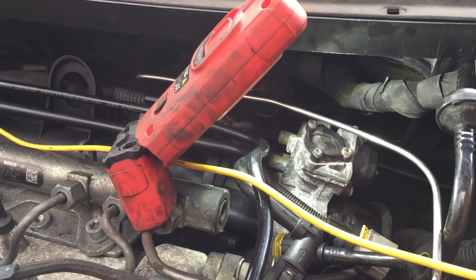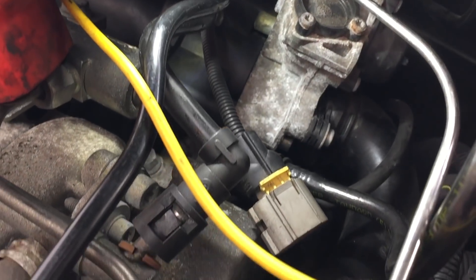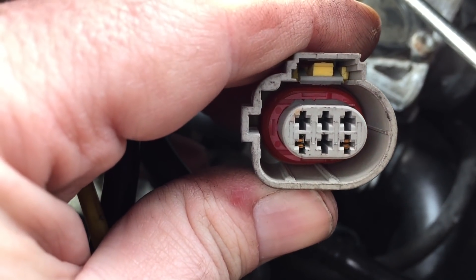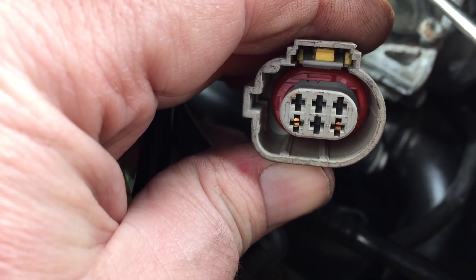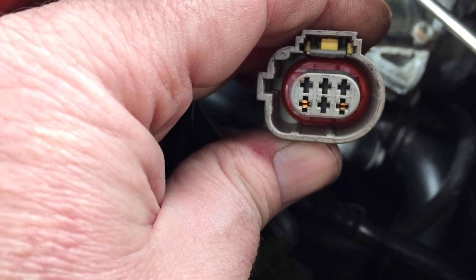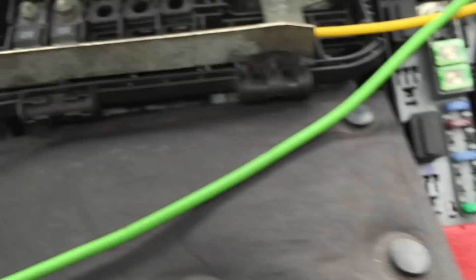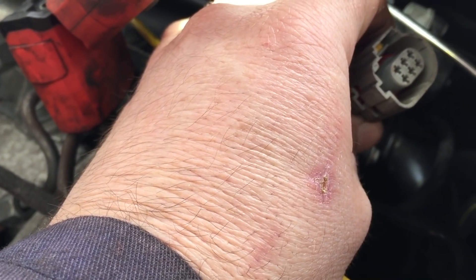Here's another thing - I thought I'd check out the EGR valve. It resides down the back there. I've got the six-pin connector plug but there's actually only two pins of that populated. This EGR has no position feedback to the ECU, so it'll just be 12 volts and a pulse ground. When we're cranking we could check if we've got a constant 12 volts, because that comes from this main relay again down here - which supplies that with 12 volts, along with the intake manifold runner and the turbo boost actuator.